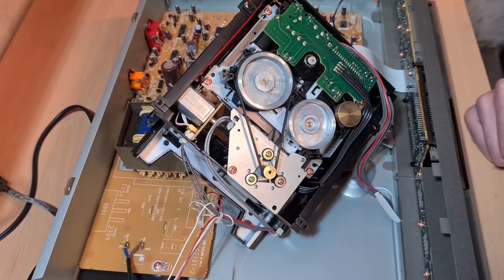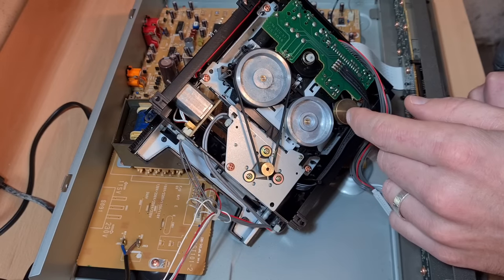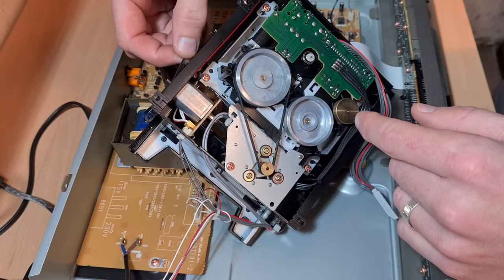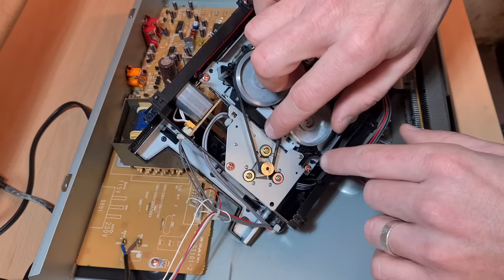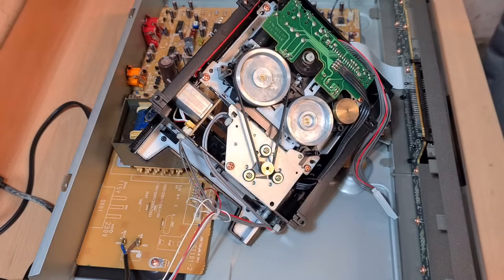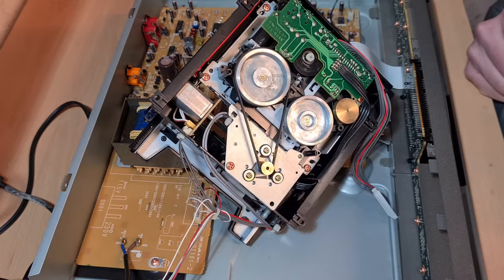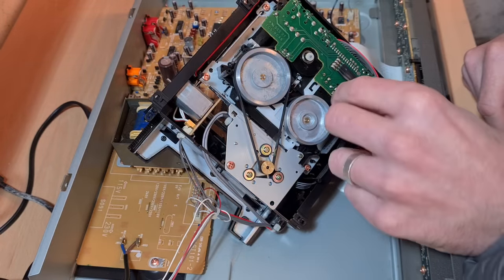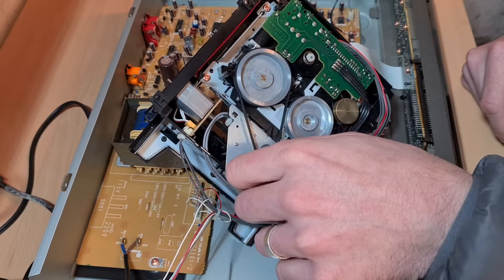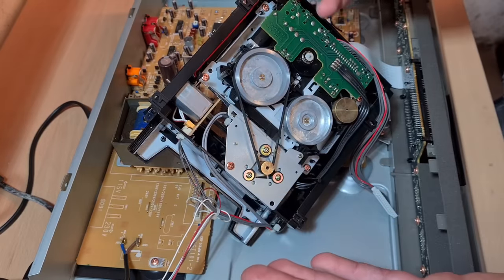That is one hell of a belt system. We have one belt here - the belts look absolutely fine. We've got an eject belt on the side over here which feels a bit loose. But these drive belts are flat drive belts - dual capstan obviously because it's auto reverse. They look fine. I was hoping to pull some belt gunk out and have a really good reason as to why it's not working, but it kind of looks okay. It is all turning. It feels tight enough - the capstan moving. Maybe there's a separate belt for mode select or something.